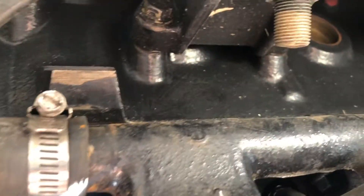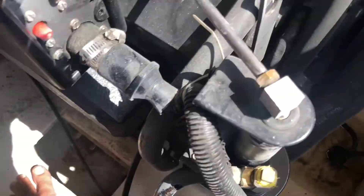Okay, so after you've removed the spark plug you're going to connect — you're just going to screw in the compression tester. Sorry, I don't have a great shot of this, but you can kind of see it's just connected right in, the same way the spark plug would connect. You just screw it in hand tight.